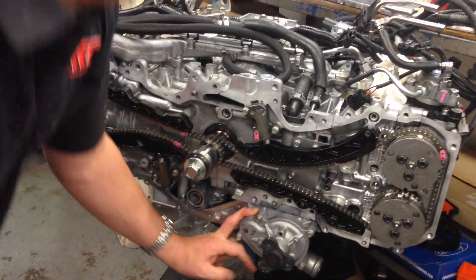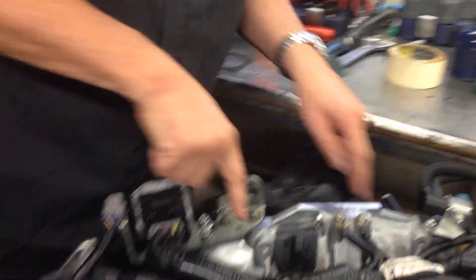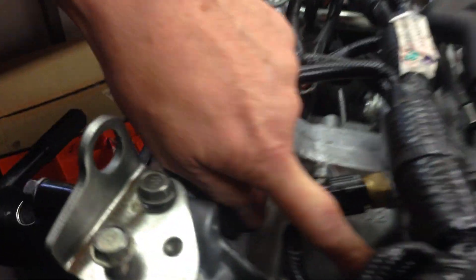Last but not least, I just want to touch on one other small thing which is a little bit of interesting knowledge. In the back here you'll see there's a sensor just down there, and there's one here. Now they are the two dual knock control sensors that effectively act as microphones, sending important information back to your engine management. If you're doing an engine rebuild on these, it's critical that they are refitted at the right angle to work in harnessing the noise that they measure inside the engine.